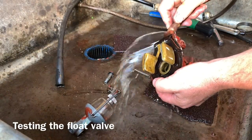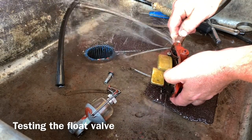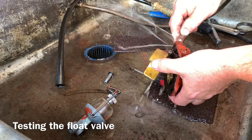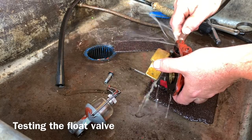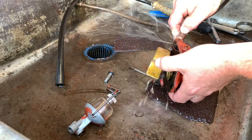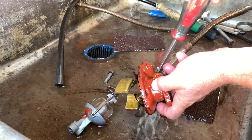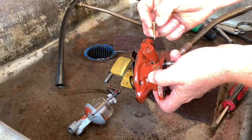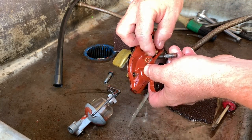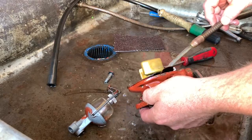To test the float: see how it's coming through? If the float is up because the bowl is full, it shuts off — so it's got positive shut-off. And of course we're blowing through; this would represent the carb empty, and then it would slowly go close. So the float is functioning correctly. We know the float is shutting off properly. It looks good.